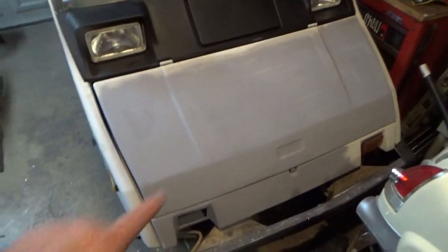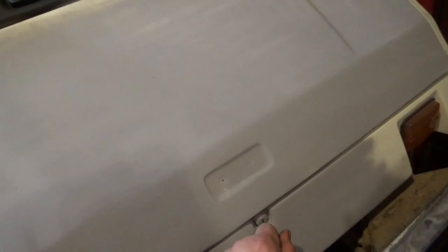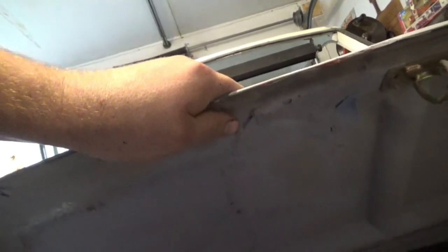It's been a couple of days and the hood is done. You can hardly even tell that anything has ever happened except for some small markings here and there — I'll call that acceptable. It still opens! Underneath, there is one thick spot right where that area was bent down and I couldn't get it back into shape. I'm actually going to take my belt sander and grind that down to make the thickness uniform.